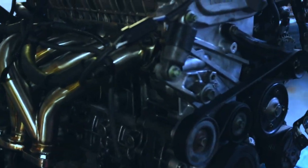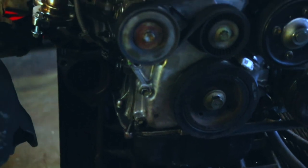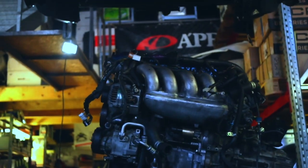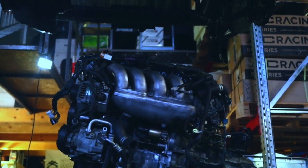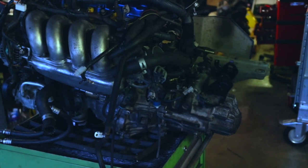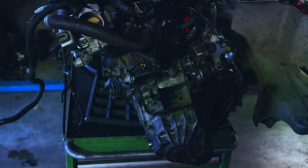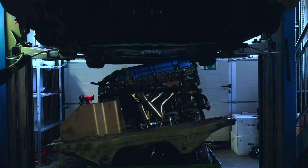Welcome back to the warehouse. Today we're going to be dropping that engine into the MR2 chassis. In one of my previous episodes I actually destroyed the front cover — it was the alternator bracket that broke off. I replaced that, had to reset the whole timing chain. Once I got all that done, I bolted the transmission back onto the engine. Since my clutch hadn't come in yet, I put the stock flywheel of the 2ZZ in just to make sure I could crank the engine, so there is no clutch inside at the moment.